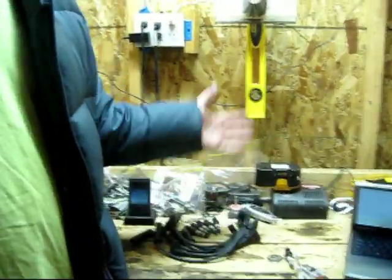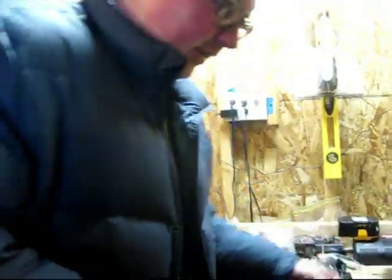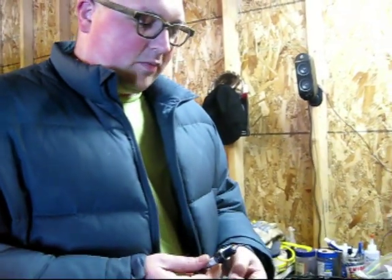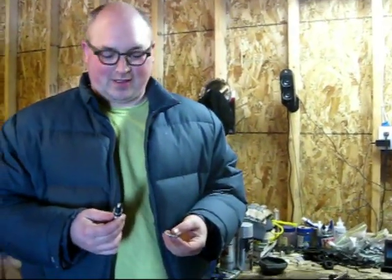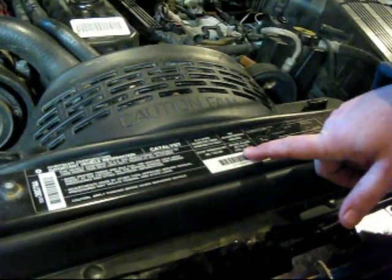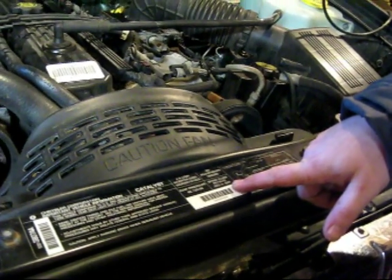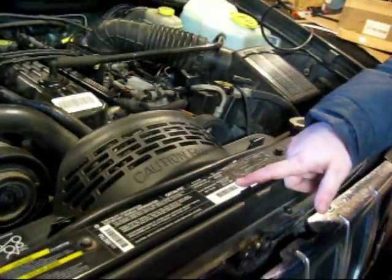As you can see over here, I've got six cylinders, so I've got six spark plugs. One thing you want to do — you don't really need to, but they say you should always gap your spark plugs. That's just the gap between the electrode and the other thing. What I should set the gap to is thirty-five thousandths of an inch. Or you can just Google it and find a couple sources that match up on the internet.